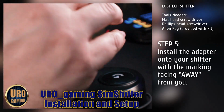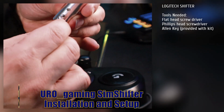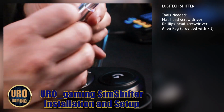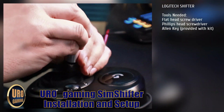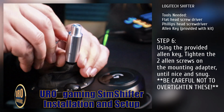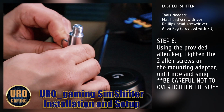There are 2 Allen screws on there, and you'll use the Allen key to tighten those up. You should start with them a little bit loose, just so you have enough room to get this onto the shifter. So you'll slide this on all the way in. Make sure that black marking is facing away from you, and tighten up these 2 Allen screws. Just be careful to not over tighten them.